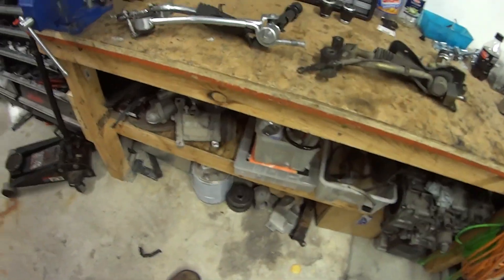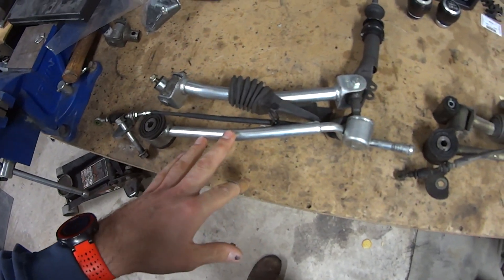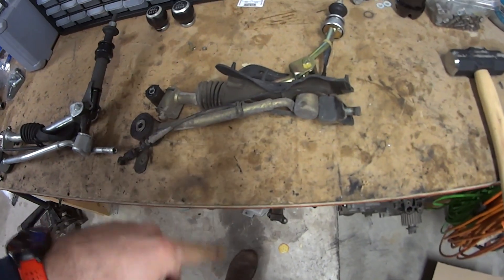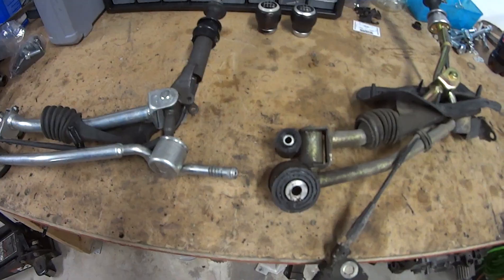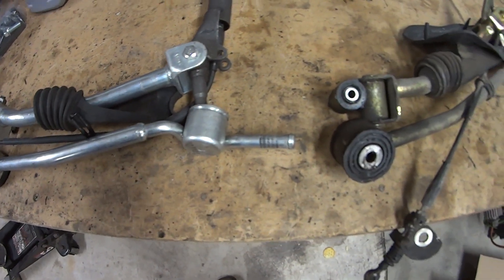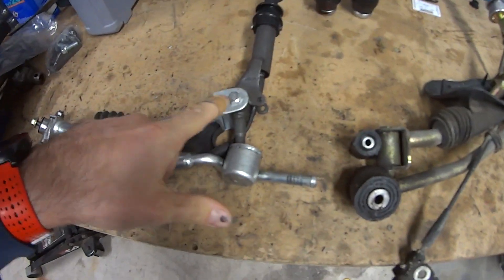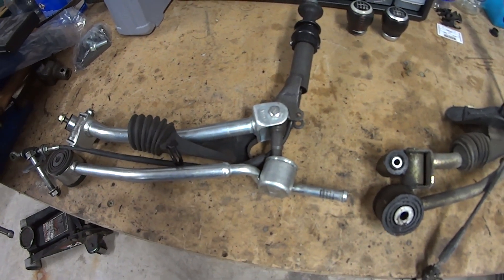Pretty much got all the things to finish the 6-speed swap, and I'm looking at the shifter linkage which just showed up. On the left here we have the shift linkage from the 2009 Subaru Legacy GT Spec B, and here we have the shift linkage from a 2004 WRX STI — definitely looks a lot crustier than the Spec B. I'll try to use the newer shift linkage, and all we really need is this bar and this bar, so everything else should be able to be reused.